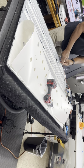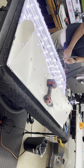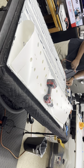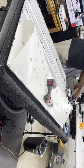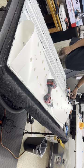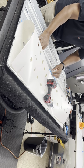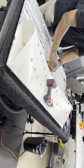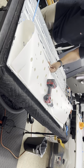Okay. Okay, so those all light up. It's three together and then it's two together on this TV. Two strips and then three strips. So they work, they're fine. What I will now do is get them stuck on and then we'll fire the whole screen up at one time. So remember, the A has a circle, so always stick the A's on first and then follow suit with the B's.